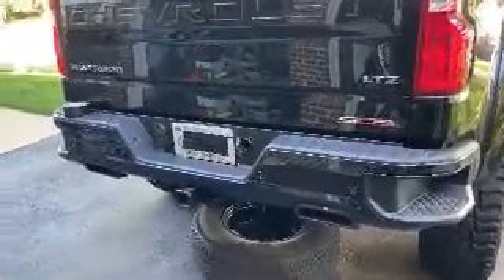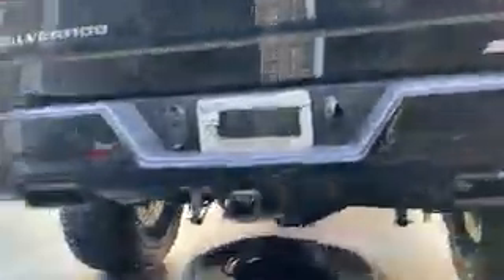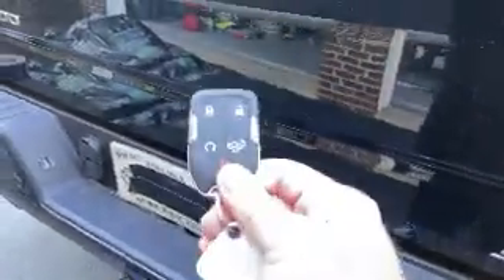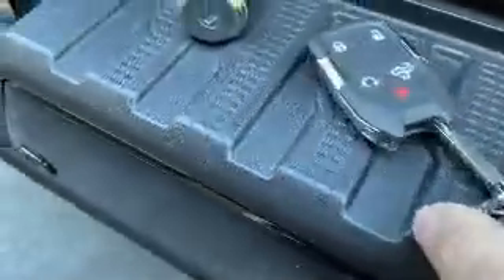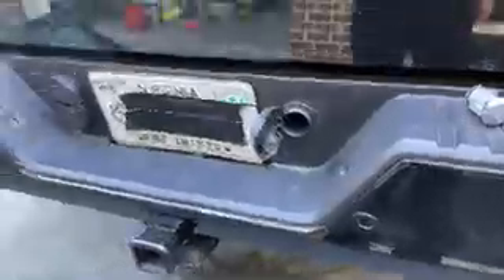Initially, you have to get the spare tire out of the vehicle. If you've never gotten your spare tire out of a 2019 Silverado before, I want to show you how. It's really, really simple. You have this piece right here, and this lock is in here like this. So you take your key — it's not really a key, but there's a button on the side right here — and you press that button, and an actual key comes out of the unit like that. That key goes into there, and you remove that lock, which gives you access to your spare tire.